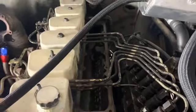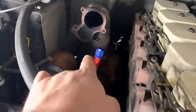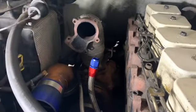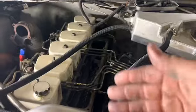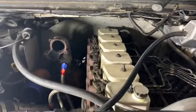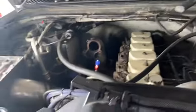It's the next day — I got the plate completely removed, got the turbo and manifold all out, and now I'm ready to start reinstalling everything. I'm going to jack up the turbo to get it back to the right height, reinstall the manifold, and place just the exhaust housing on there to see how much I need to cut off the hot pipe. I also need to redo the intake pipe — replace a flange to add an O-ring boss — and change a few things on the intercooler pipe. Then it's all about painting everything and making it look nice, which will be in the next video.